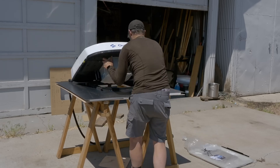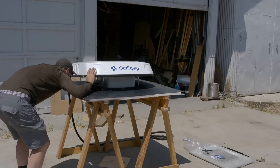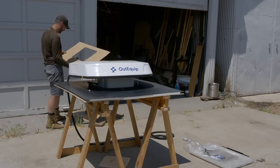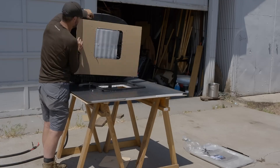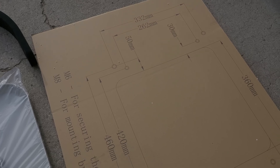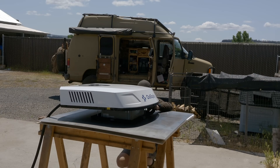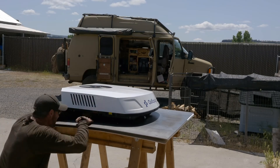As I started to attempt installing the OutEquip Glacier Pro on my mock-up roof, I discovered I had made a major mistake. When I set the template down and drilled the holes, I didn't pay close enough attention to the fact that the template was directional. At first glance I thought all the bolts were square to the 14-inch opening, but that was not the case. When I do the permanent install in my trailer, I'll be sure to mark on the template which way goes towards the front. I'd recommend that OutEquip add arrows to the template to make it clear to the installer which direction it should face.